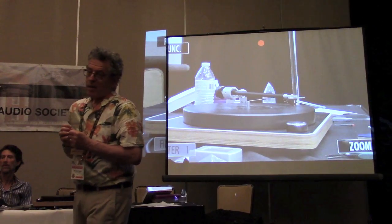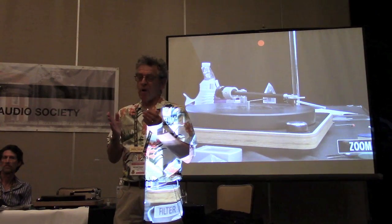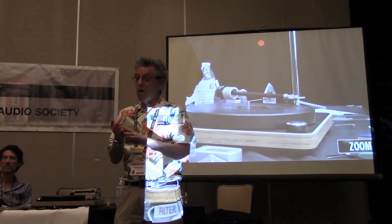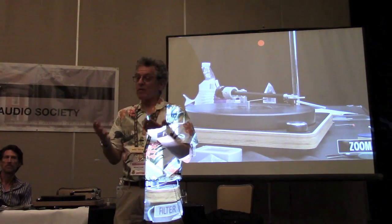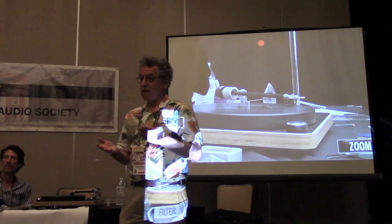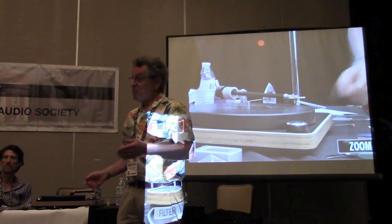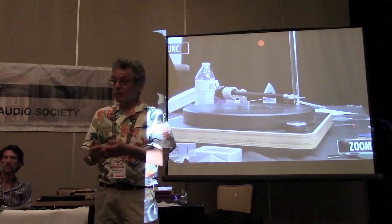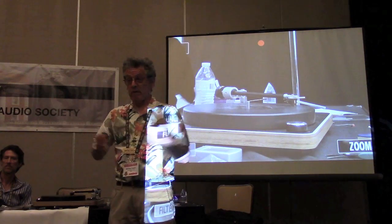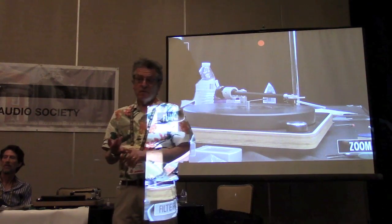What would you recommend? That's a tough question, but I think the minimum turntable you should buy is either a Rega RP1 or a Project Debut Carbon. So $400 to $500 can get you a pretty decent turntable. And if you get something like a Project, it'll come with one of these Ortofon 2M Reds, and it'll sound okay. If you switch to a 2M Blue, you can even just change the stylus out, get a 2M Blue stylus. It will get much better. And once you hear that, then you'll start with mats, and it gets pretty crazy.